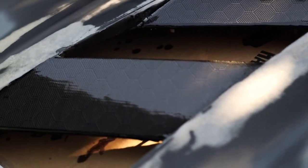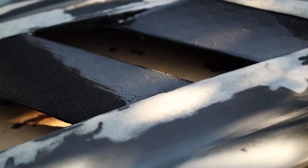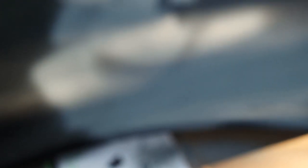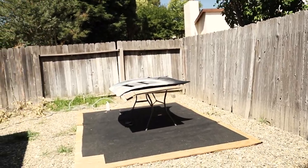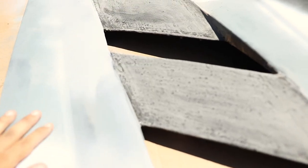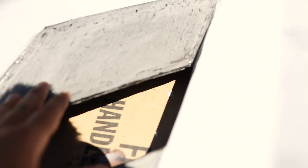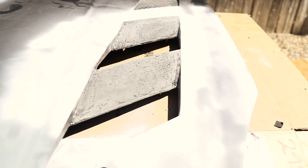The vents are looking good so far — they're starting to get their shape and reaching their final stages. What I'm planning to do is once these things dry down, I'm going to sand this hood as much as possible. You can see it still needs a little sanding. Then we might apply one more resin coat, or we might just go straight for the clear coat. The hood's looking dead right now. I had to add a little bit of primer, and most of the vents are showing gray — which is exactly what we want because it means the surface is flat.